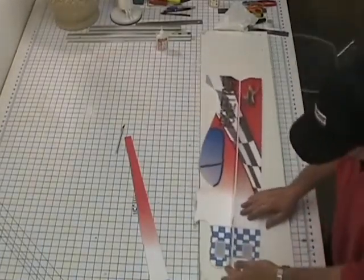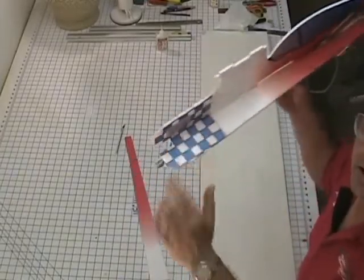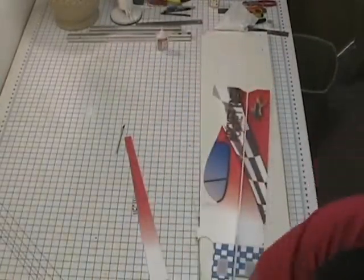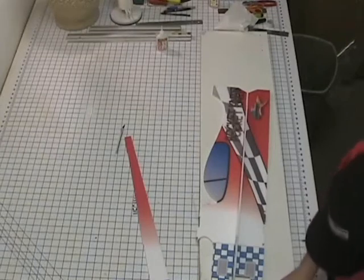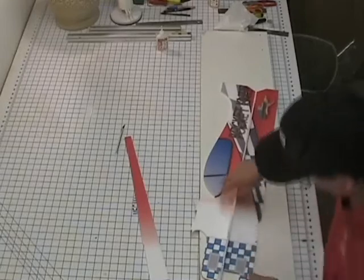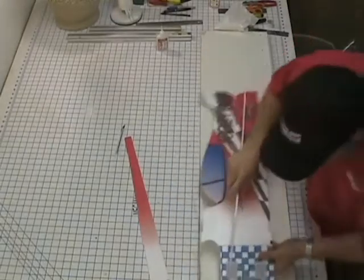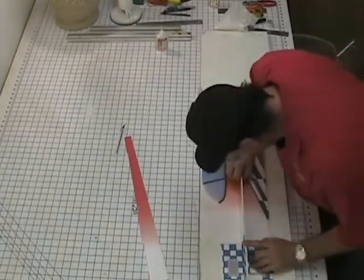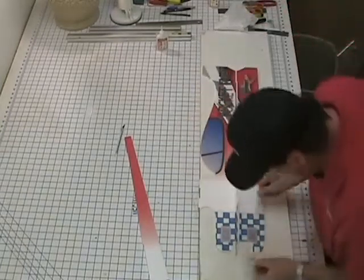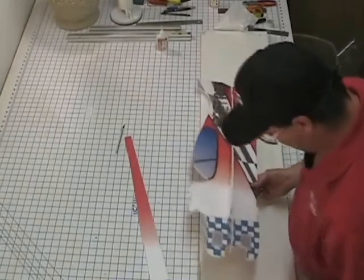And you'll see here that these two silver lines, I call them cowl lines, are lined up. But more importantly is the firewall, to make sure that your firewall is going to have no up or down thrust. As I move this cross brace fore and aft, it's going to change the thrust up and down. So you want to get everything slid in there, looking good, and then just give a check on the thrust line. Everything, yeah, that's going to work out great.